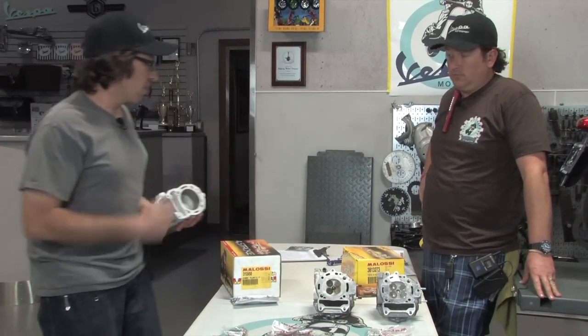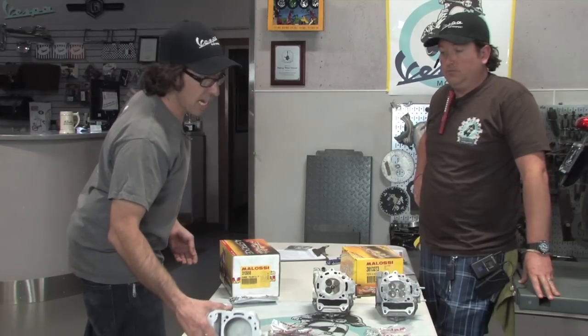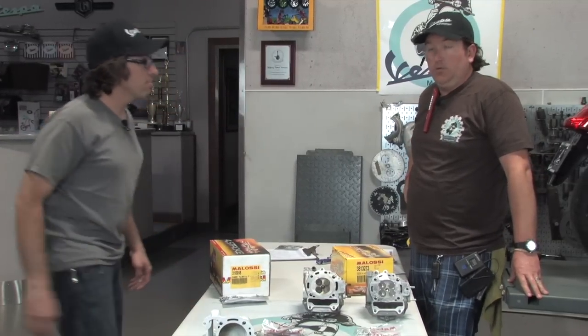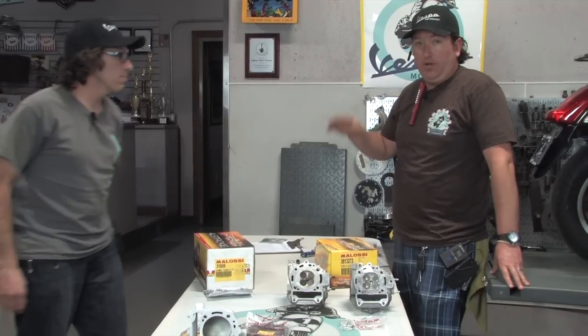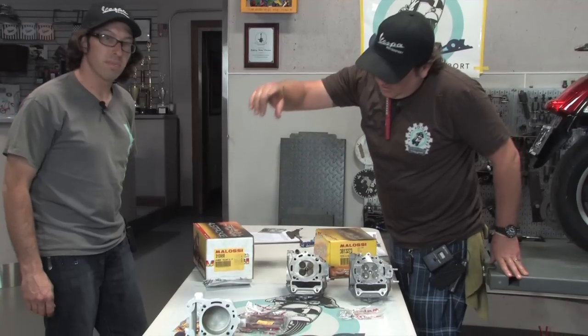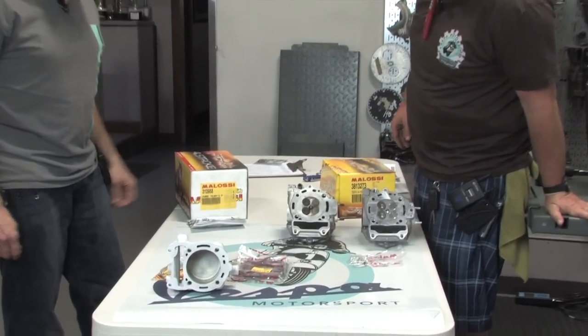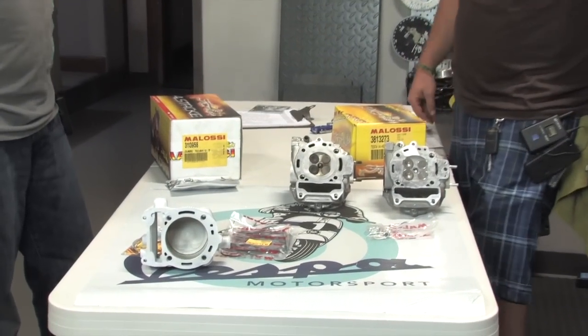And Steve's going to go over the different part numbers for the various cylinders and what the actual cylinder sizes are. So what we're going to go ahead and do is start at the top and work our way down. So for the 300cc motor, that's the cylinder that Robot was fondling there. The part number on that one is M311-3958, and the actual bore on that is a 75.5.